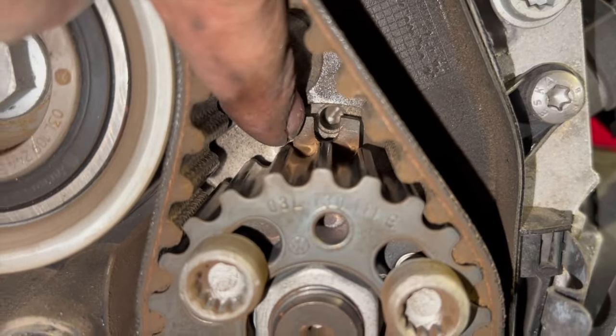You might find that your new tensioner is different, but there is actually a bulletin from Gates. The new tensioner doesn't actually have the locking peg on it. You just put it on, and then when you tension it, as you put tension on it, it just pulls and sits where it wants to sit. It doesn't actually have a locking peg, that's all. I'll just show you quickly the old one. If it does have the locking peg, it sits in that position there, that's all. So it's quite a common bulletin interchange, that.